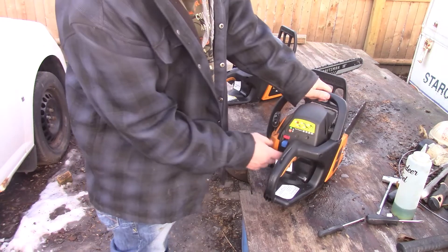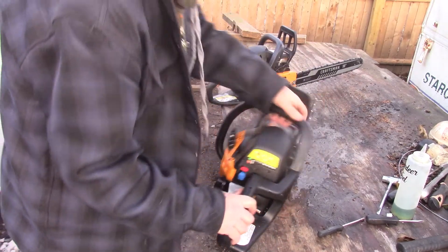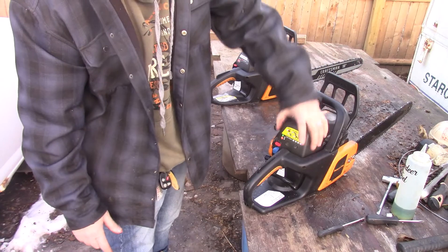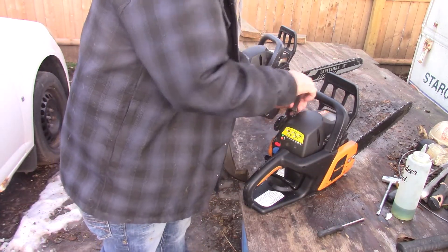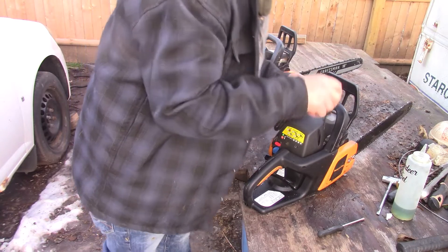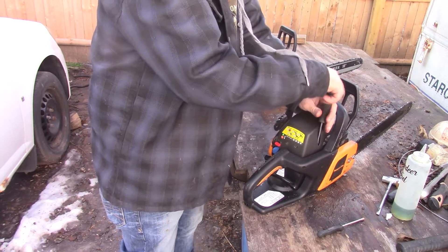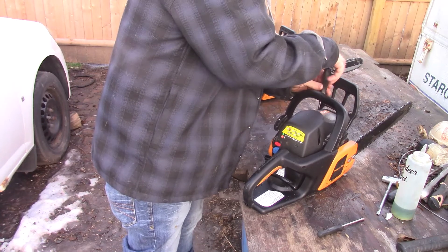As you can see, these covers are pretty solid. You have your holes up here where your low-high is, and it looks open through there, but on these right behind the carburetor there's a big rubber dome. So when this cover sets down it's sealing around it where your air filter and all that is. There's really no spots for it to actually gain air access besides where your throttle is to adjust your idle speed — you have a hole there for air — and for your high-low you have the bigger hole. So there's really not a lot of air access to it. I get where that guy's talking about now because it just has those three openings.